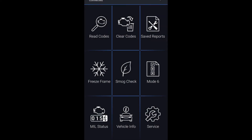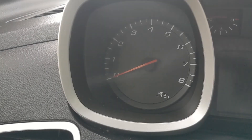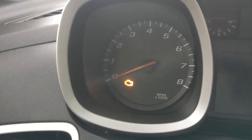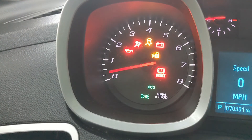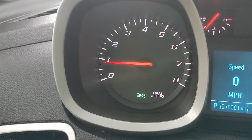So we go in here and check the codes. Interesting — it says it's a permanent code. The only way this one gets reset is if the vehicle itself decides that it's cleared. It looks like what we're going to have to do is just drive this thing around, put a few miles on it, until the ECU decides that it's no longer a problem. It took about a week for it to decide that was the problem — hopefully it doesn't take a full week to clear it. I just took it for a drive around the block. And there you go — check engine light is clear. Looks like we've solved the problem. That's all there is to it. Thanks for watching.